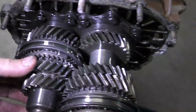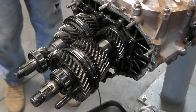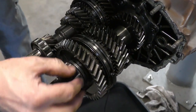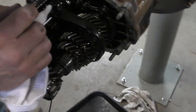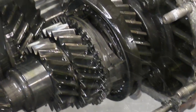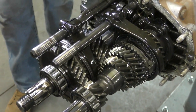Third and fourth gear synchro is definitely done. Third gear synchro is average. I'm just going to flip it over to see the selector fork. Looks like they didn't do any of the bearings back here — doesn't look real horrible. So fourth gear would be like that. I would say this has not been rebuilt before. This is just a used transmission.